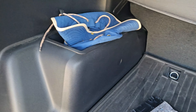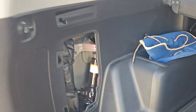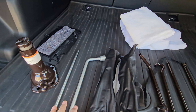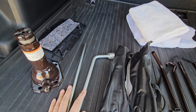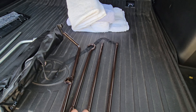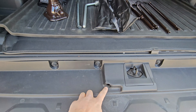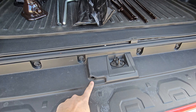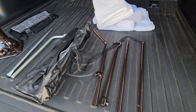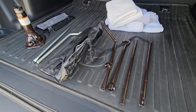As you know, the jack is located here on the driver side access panel. In the bag of tools we have four brown pieces and two silver pieces. The two silver pieces are what we'll be using to take the tire off. The brown pieces are what we construct to make the handle attached to the jack, and also for removal of the spare tire underneath the 4Runner. I've shown that on a separate video — you can check my channel on how to remove the spare tire.